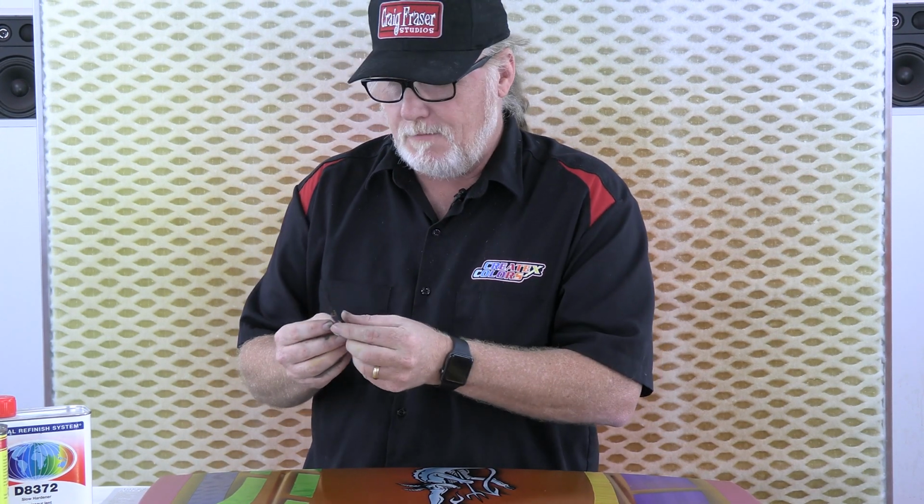If you're a left-hander, your pointer finger goes there. So this stick is always facing left because you can tell this is the blade, the part you're striping with, but when this is covered in paint, you can't tell which side is which. So always remember, flat side to your left.